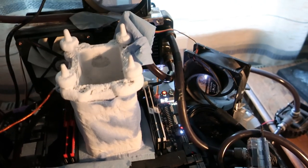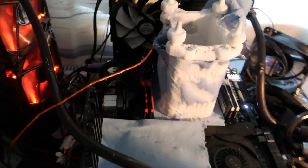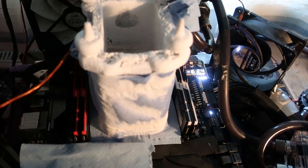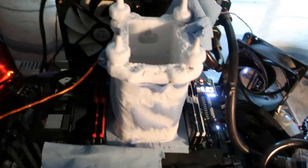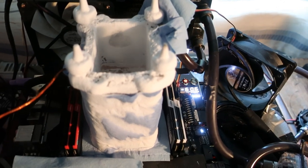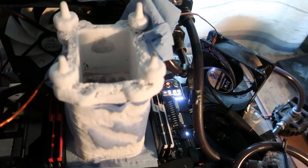So it seems now that I have managed to bypass the cracking, at least mostly, based on the die temperature on LED. But I'm not sure if the pot is too tight against the CPU and causes some issues with memory, like IMC, because I have some weird issues after like minus 115 where it gets some memory instability issue, and it forces reboot of the POST process. So I'm not sure what's going on. But overall the CPU is very good, but this is definitely the only way to bypass the cracking, mostly by tightening the pot really hard against the CPU.